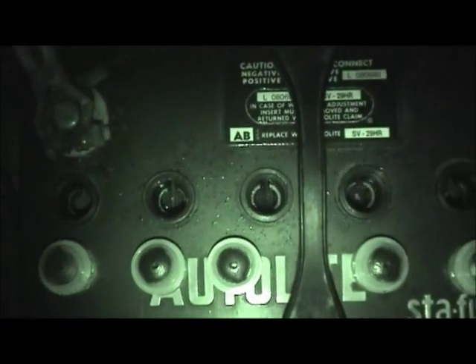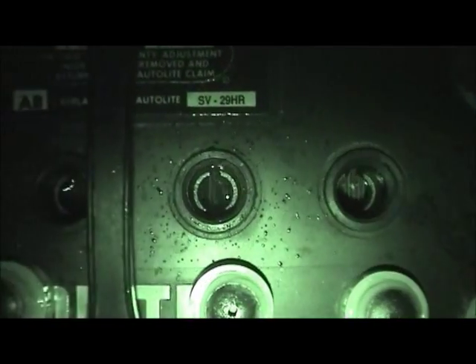Essentially what's going on now is that you've got what was a 12-volt battery reduced to 8 volts. The reason why the charger's putting on 5 amps and the cells seem pretty busy is that this 8-volt battery is essentially being overcharged at 13 to 14 volts by the battery charger. If I continue to charge this battery in this condition, it's basically going to ruin all the other cells — it's going to gas excessively and cause a lot of damage. The plate material sheds off and lands at the bottom of the battery, builds up over time, and starts to cause a dead short.